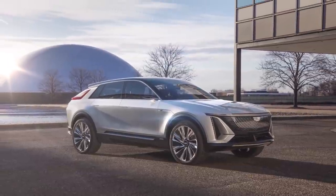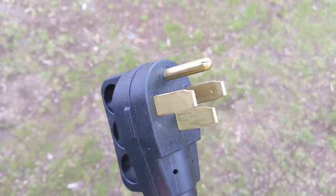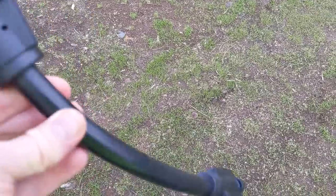With the Lyriq charging at 20 kilowatts, they need to ship an EVSE that supports at least 30 to 40 amps — unlike this one that can only support 12. Having quick-disconnect plugs so you don't need this workaround is something GM and really any automaker should consider for their stock EVSE. You should have the option to avoid the additional expense of a dedicated charger install if you don't want one. Anyway, I hope this was helpful and informative — if you enjoyed this video please like and subscribe, it really helps out the channel.